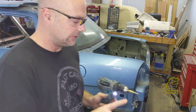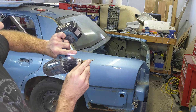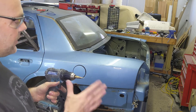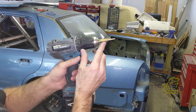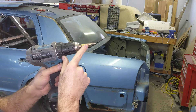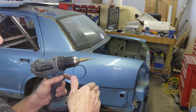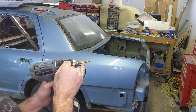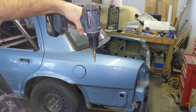Normally I would have just used the step bit all the way through, but this section of the bit is burned up and kind of useless right there — it just stops. But I've gotten past that point using my other drill bits. I've got red marker on this area showing how far I need to go. If you've got a hole to drill but you only need a certain depth, take a marker or a piece of tape and mark your bit so as you're drilling you can see that color spinning and know that's how far to go.